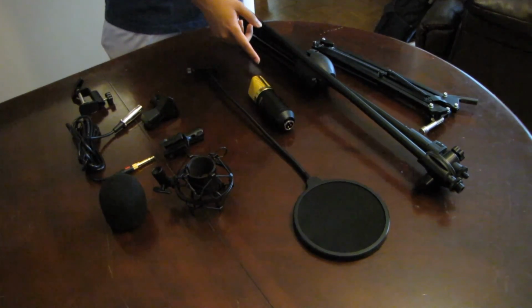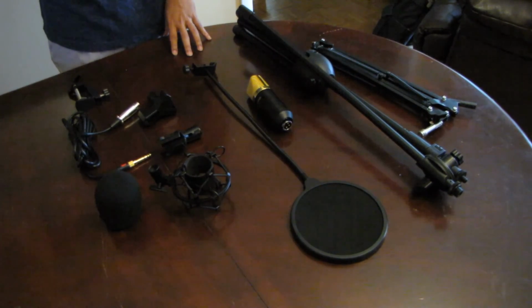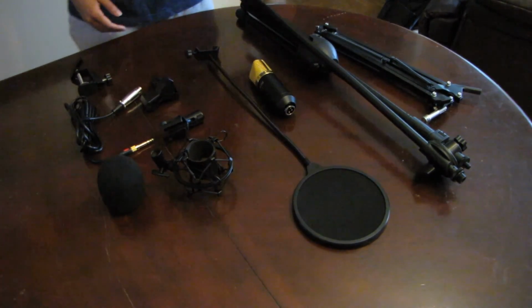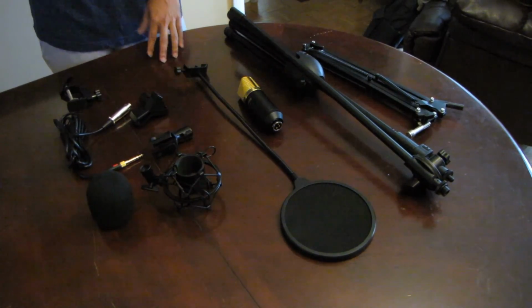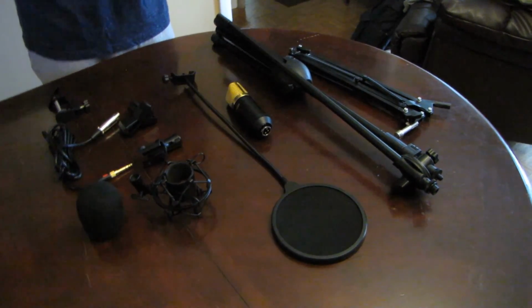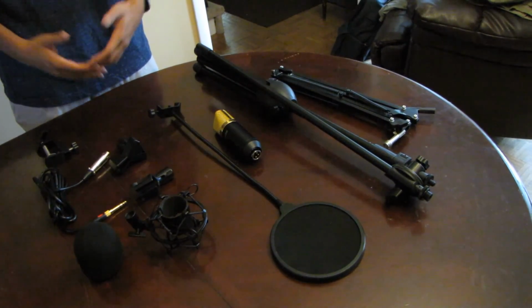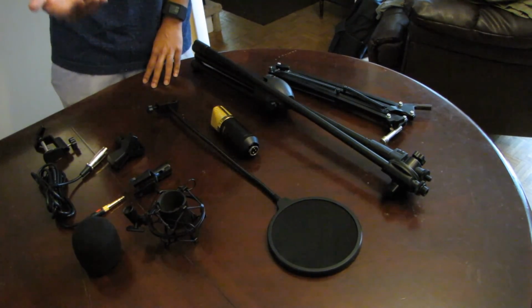The AK-70 condenser mic uses a new audio circuit which captures sound from sources that are directly in front of the mic. The cardioid pickup pattern minimizes background noise and isolates the main sound source. The AK-107 metal microphone stand is a durable tripod stand and 10-inch/25cm boom combination. The folding legs with rubber are designed for durability and reduce floor vibration. With the stand, the mic can go from about 31.1 inches to 52 inches in height. In centimeters, that's 79 centimeters to 132 centimeters in height.